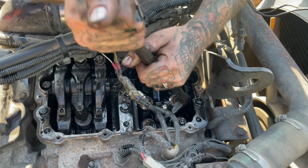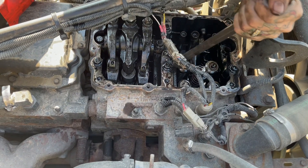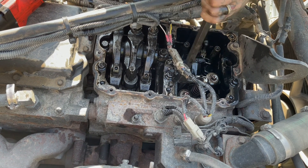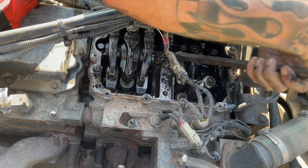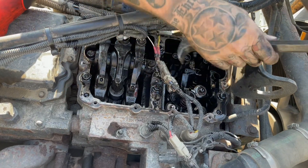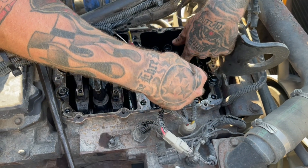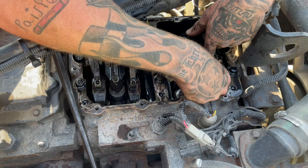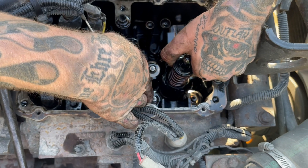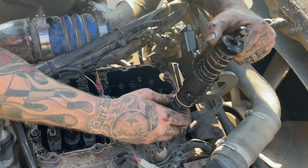Take your pry bar, grab the top of the injector, and you might have to go on both sides. A lot of times these things can be stuck — you've got to wiggle that sucker and get it out of there. Now that we've got it popped loose — this is actually just a plunger, so once we compress that spring we put that handle back down under it and that takes care of it. You can see the injector hold-down popped up, so you can pull it out — I usually just leave it sitting right there. Go ahead and unplug it, and then we've got our injector out.